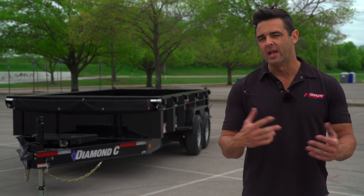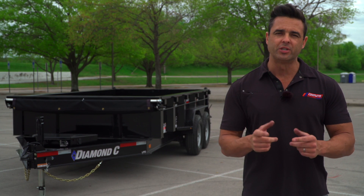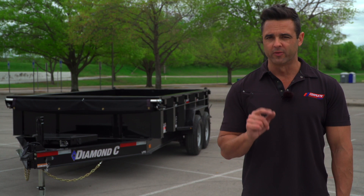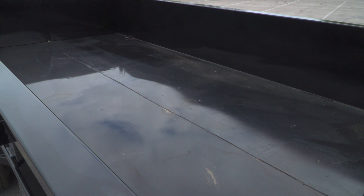You can add extended sides as an aftermarket bolt-on accessory, or take a look at one of our trailers stocked with 44-inch sides. You can go 32-inch or 44-inch sides. The cautionary thing here is that if you've got 44-inch sides and you're loading sand, gravel, rock, or cement, you are going to be overloading that trailer if they're Tandem 7s underneath. If you're hauling garbage, trash, and debris, extended sides are a great idea — but you have to be cautious about how much weight you're adding.